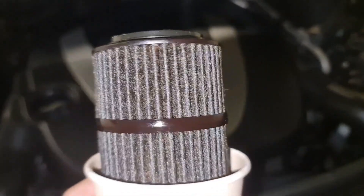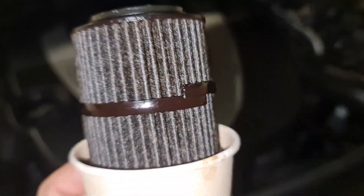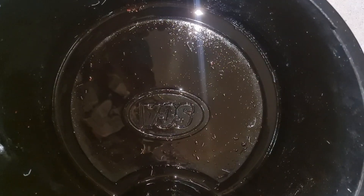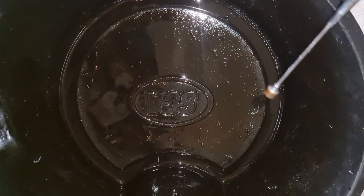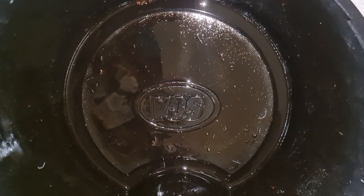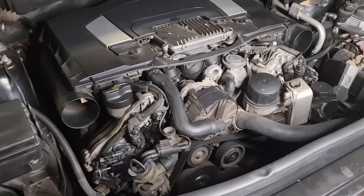Also check your oil filter — inside and outside — to see if you spot any metal shavings or particles. In this case I can't see anything wrong; it's dirty but no metal shavings, which is good news for this M272 engine. Another way to check for metal shavings and particles in your oil is to use a super magnet to see if you catch anything on it. In this case, except for some leaf and debris in the bucket, I can't see any sparkling shiny debris, which is also good news.